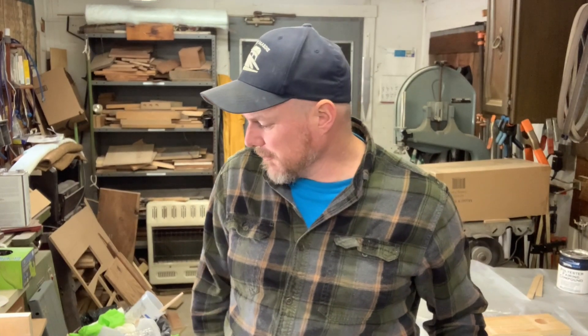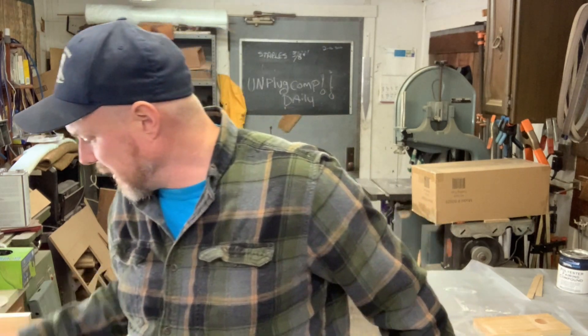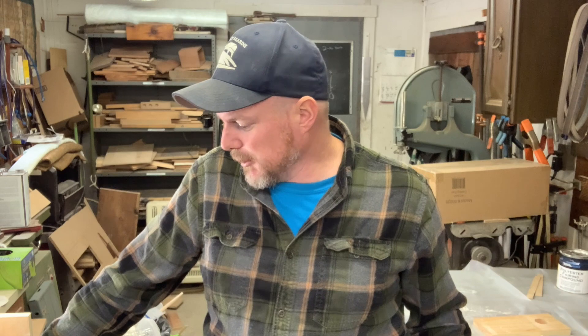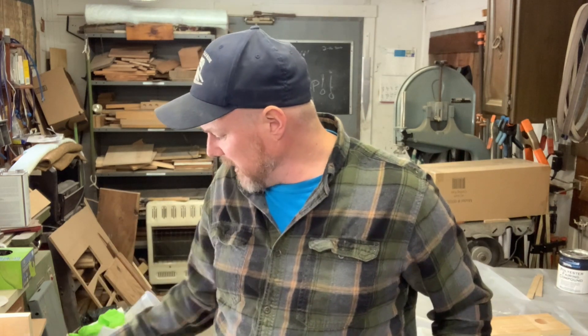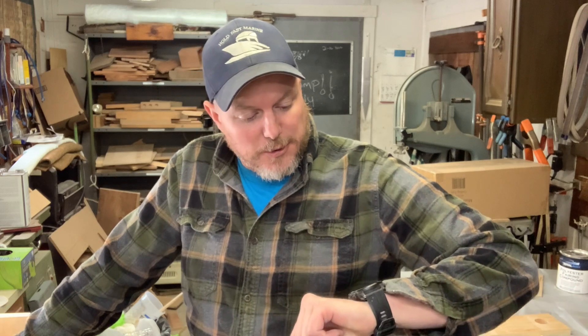It's pretty well dry — it's been about an hour — and it's all ready to be sanded. I'm not even going to film the sanding because you guys have seen sanding before. I'm going to sand this with 80 grit this time to make it a little easier on me, then hit the inside of it with the DA, check all my edges, and then maybe just maybe spray some gel coat before I go home today. It's almost 3 o'clock, so we'll see what happens.